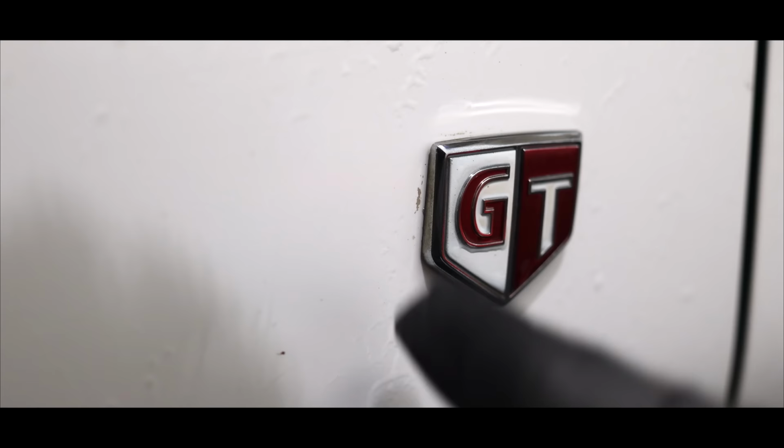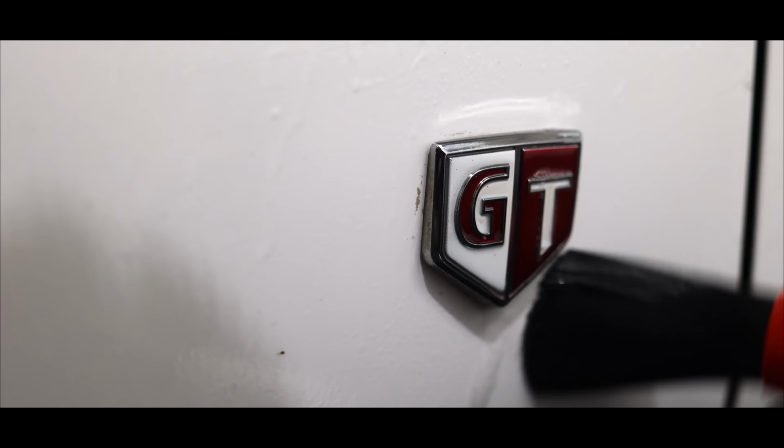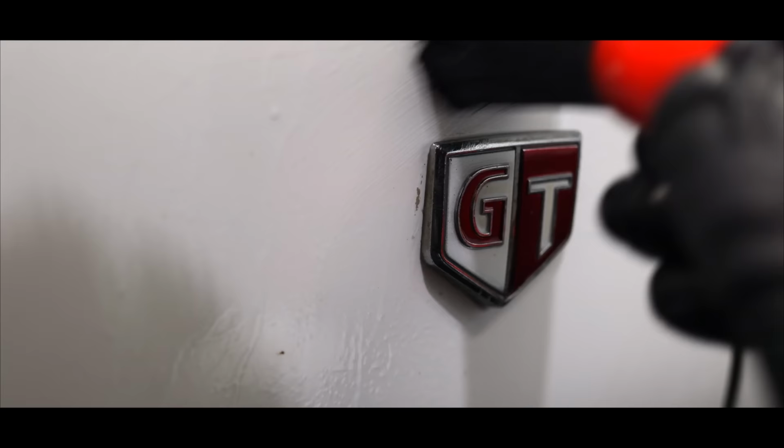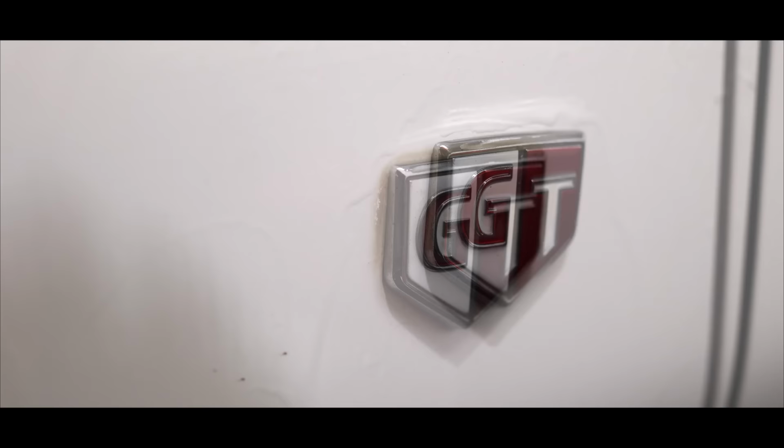And to try and get that last more stubborn 20%, I'm going to switch to a tar remover that should be a little more effective at removing it. I'll once again spray it on, give it a moment to dwell, and then once again use my detailing brush to agitate the area before rinsing it down again. Hopefully you guys can see that almost all that contamination has been removed. There's just a few specks left behind where a clay bar should remove them, and a bit of light oxidation and surfaced rust on the badge that a car polish should also clean up quite well.